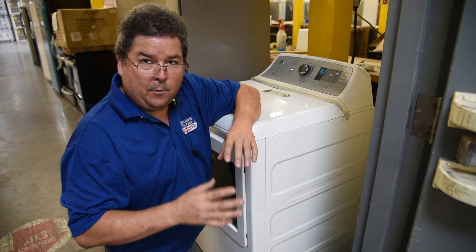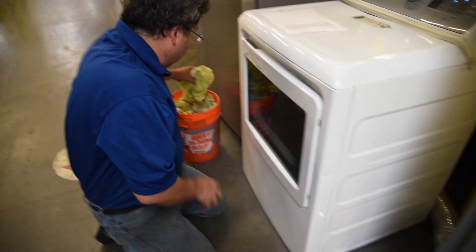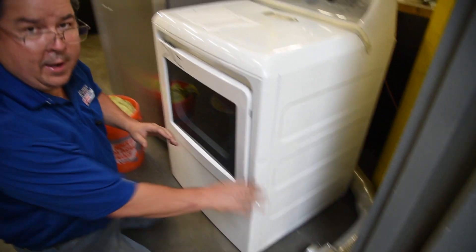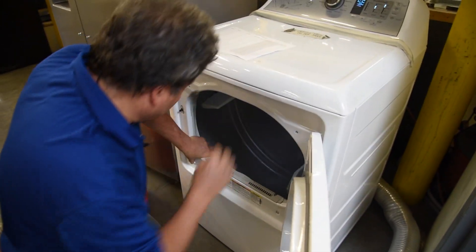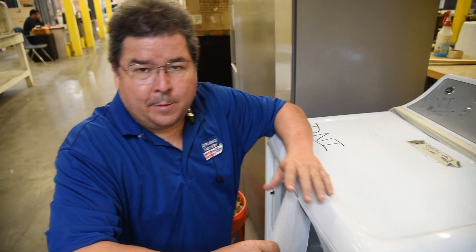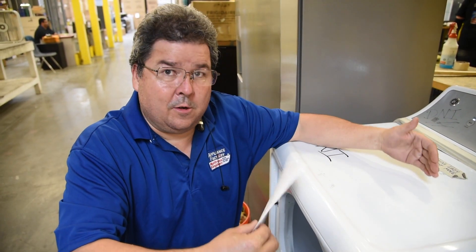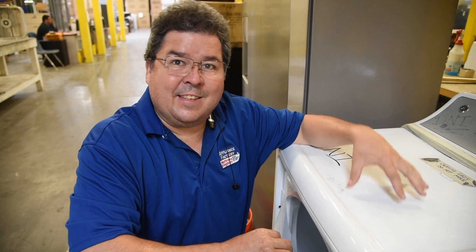When it's working correctly, take out all the fun stuff I put in here. What you want to do is take this either off of the house or off of the back of your dryer. I would recommend taking it off of the dryer because this can also have a tendency to get clogged. So we're going to do the same thing. I'm going to tell my dryer that my door is closed — be careful not to put your hand in here because this thing does turn, it can grab your finger and it would hurt. I've manually obstructed that so I could actually show this to you. Either disconnect it from the back of your dryer or disconnect it from the wall, whichever is easier, but I would recommend taking it off the dryer so you can say my dryer is either right or my dryer is wrong. If nothing's connected to the dryer and the sheet still won't hold up there, you have a problem inside of your dryer.